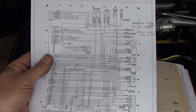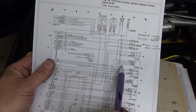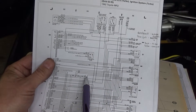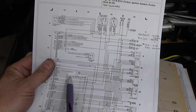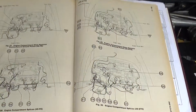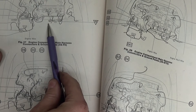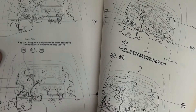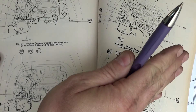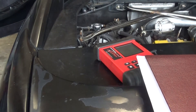I have found the wiring diagram and I can see my oxygen sensor here — this brown wire is my ground and goes all the way to the main computer and the oxygen sensor. I also have a book from the vehicle owner. I have located this ground — it's on the block behind the engine, toward the back of the car. It should be an eyelet with maybe four or five wires. I'm going to go underneath the car and see if I can find that ground and check for any voltage drop there.